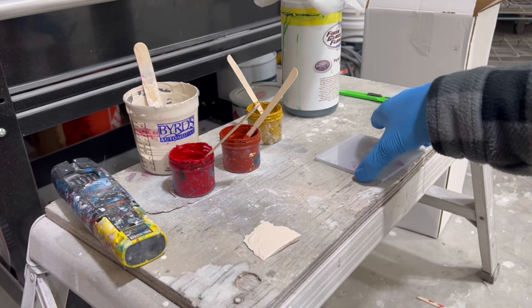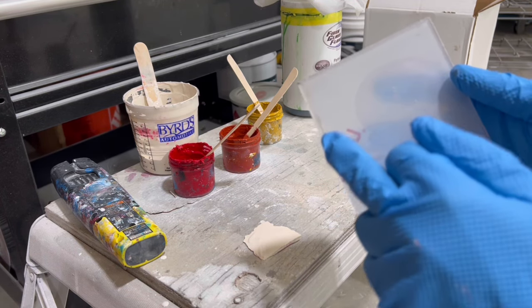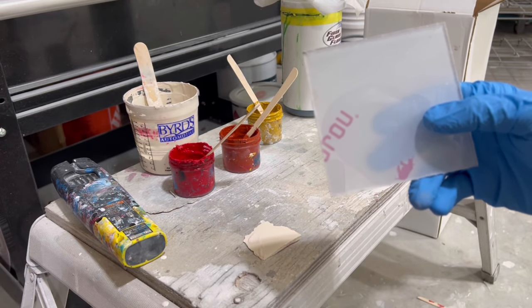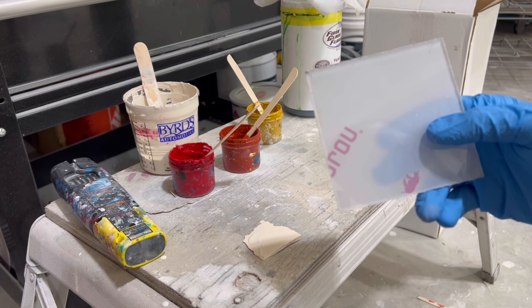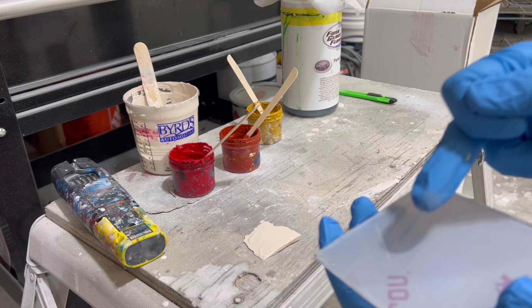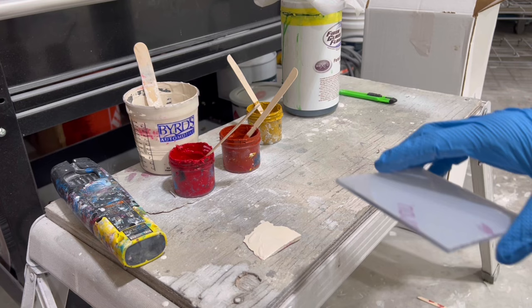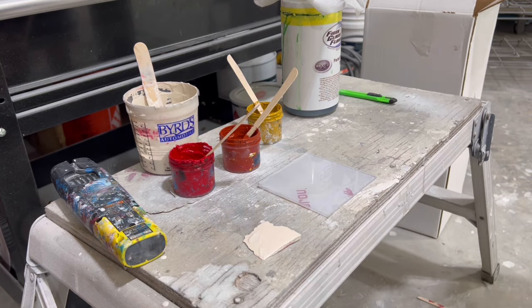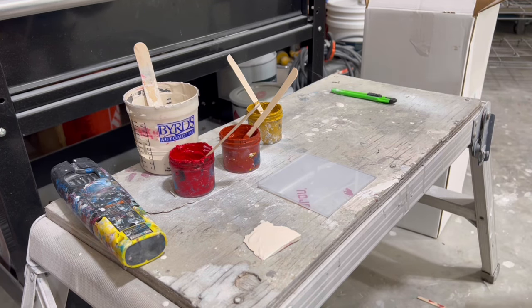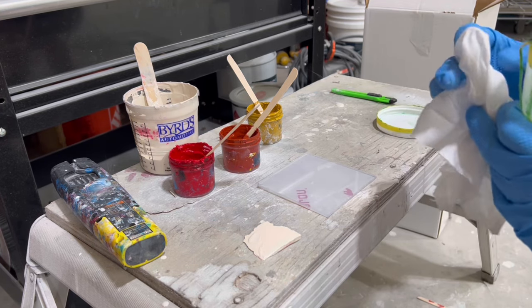What I'm going to show you today is: I'm going to PVA this little glass piece here, spray a small section of gel coat on it, and show you how to release it when it's done. That way you can hold that little piece of tinted gel coat up to the boat and see how well it matches. It's best to use a mold release wax like a paste wax, but I don't have any currently, so we're just going to go with a couple rounds of this PVA.